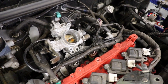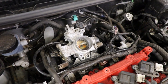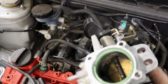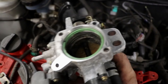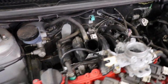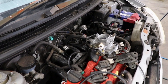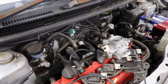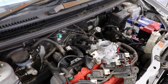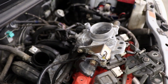That's just sort of a bit of a pain to try and emulate — I mean I could cut out a plate and shape it and do things like that, but that sounds like a lot of work. I think it'd be easier to weld a pipe on, let's just say that. So I'm just in the process of pulling the throttle body off. It's an interesting one — it's got a plastic inlet manifold and it also o-ring seals on the back. This is a factory turbo engine, and no, plastic inlet manifolds don't explode if you put boost into one — that is a complete myth.